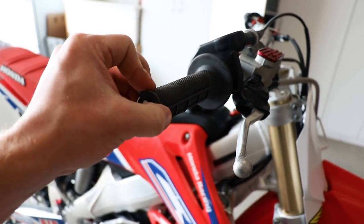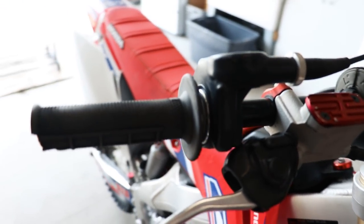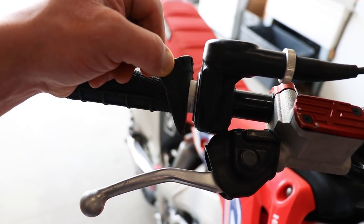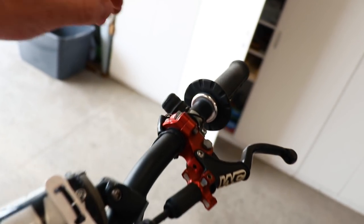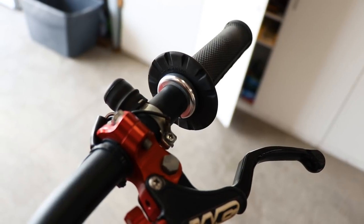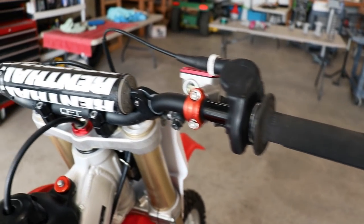You can see they're getting pretty beat up on this end, I'll need to replace them soon, but they've held up remarkably well for grips. On the throttle side, the grip is actually molded into the throttle tube, so you get the grip and the throttle tube together. On this side, the flange is actually part of the grip and that just clamps onto the handlebar — really slick idea. I'll put the link to where I bought these grips down below in the description box.